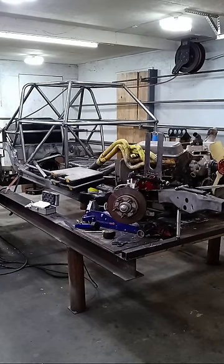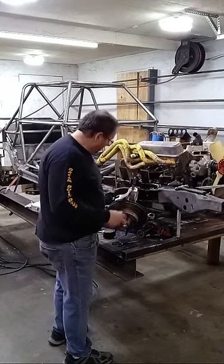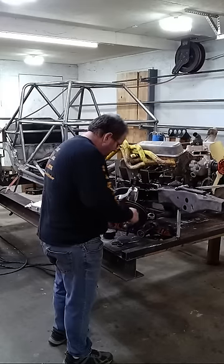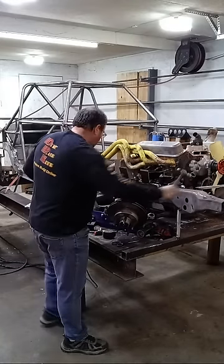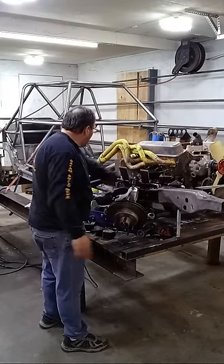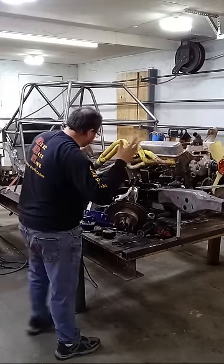Screwdriver. Pop this off. I was going to get a big pair of vice grips, too. What'd I tell you? I told you! That joker was just sitting there like, I'm fixing to jump, Jay. I'm coming loose. And I know what I'm probably going to do. When I built another car, the way I do it, I clamp a piece of steel back there. I was just trying to get an idea. When we actually do the video, I'm probably going to clamp a straight edge because we have to make sure this is parallel before we actually weld it. I'm just trying to figure my numbers out.